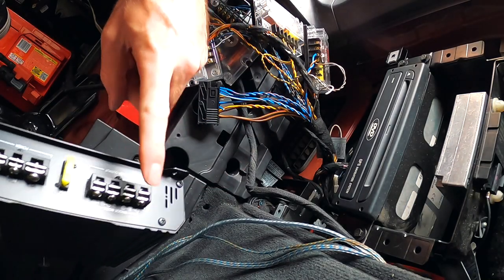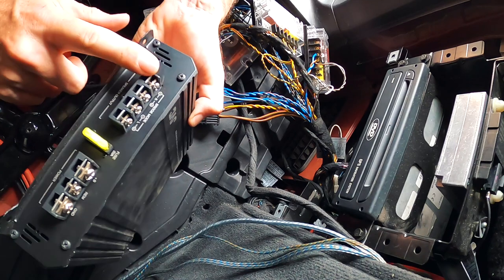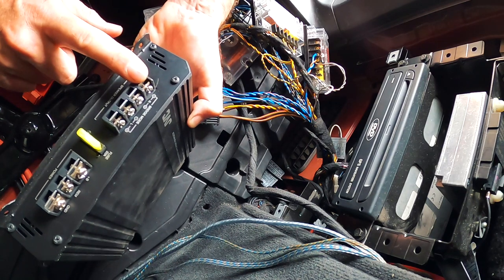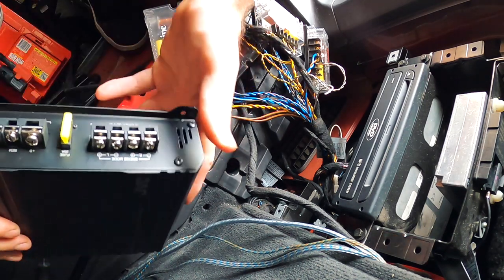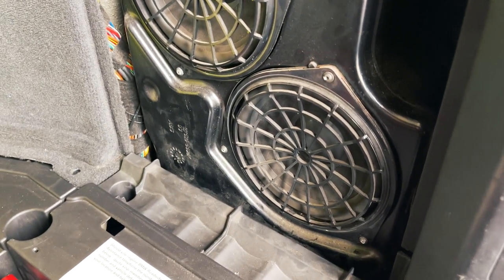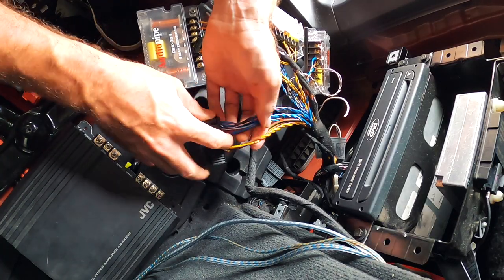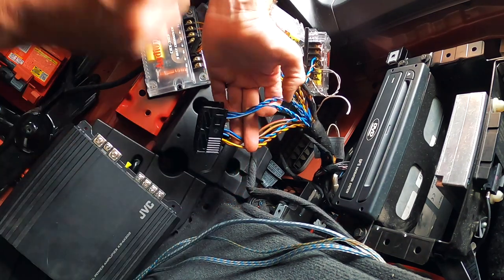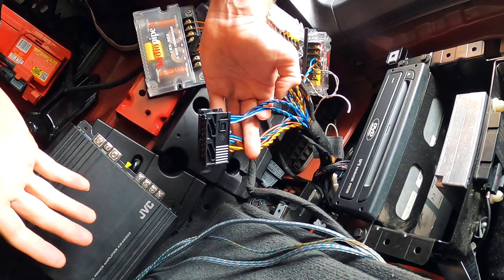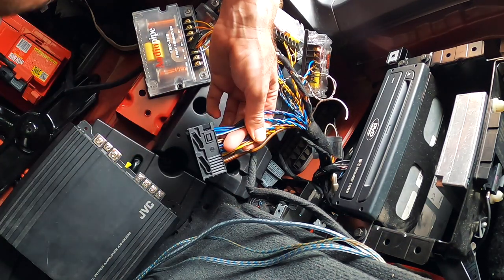It says it's a stereo amp with a bridged mode but I can't remember what the circuitry is like with the ohm ratings when it's in bridge mode — I feel like it's a fake bridge mode. What I'm going to do is, since we have the two dual voice coil subs with four wires going to them, I'm going to wire each sub in parallel which should drop each sub from 8 ohms down to 4 ohms, giving us a 4 ohm stereo setup for the subs. I'm pretty sure that's what I did on my old E53 and it still sounded like crap, but let's run with it for now and see what it sounds like.